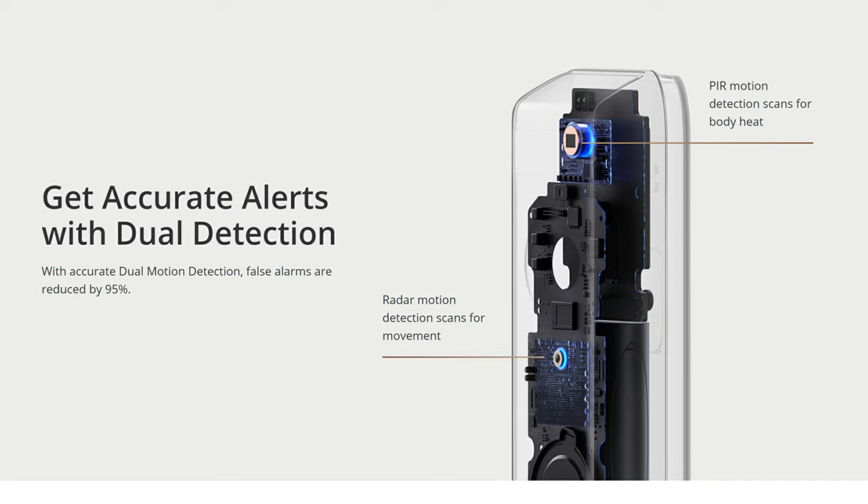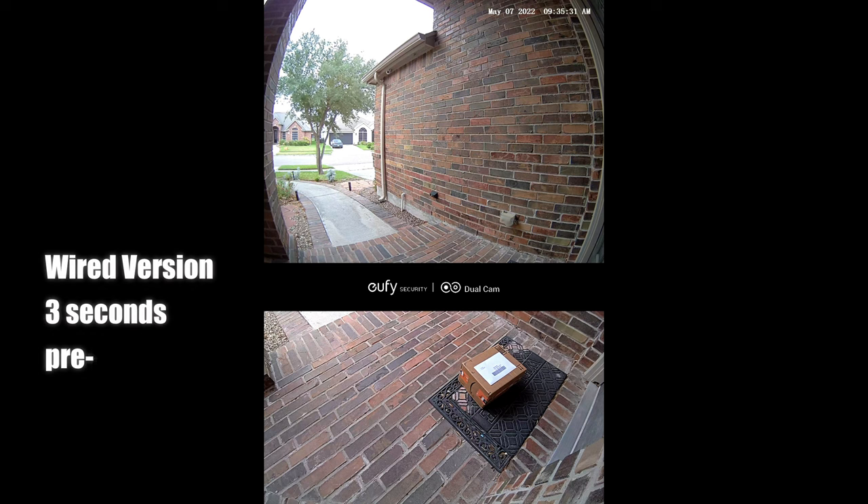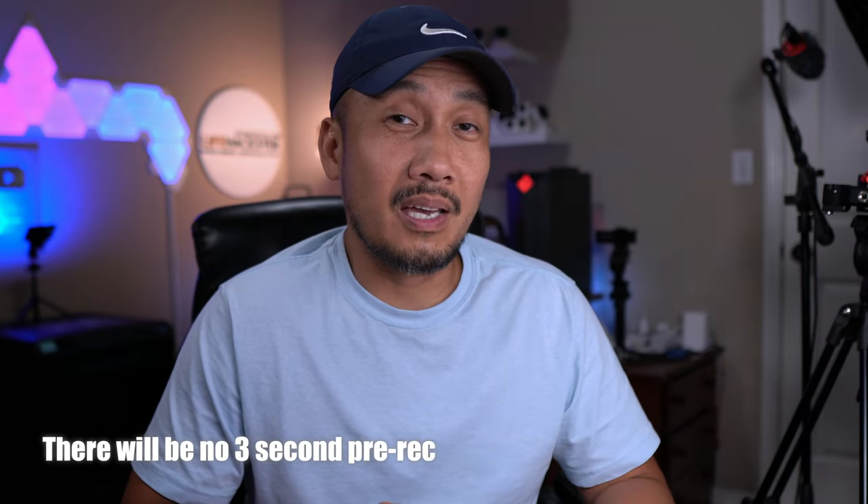What is reliable is their motion detection, and the wired version is more reliable overall. Battery-powered cameras will always sacrifice reliability, which you will see during my porch pirate testing. How these two doorbells detect motion is one of their main differences. The battery version uses a PIR sensor which detects heat movement, and Eufy also added radar detection to make it more reliable — but these two detectors only trigger the camera to record when motion is detected. The wired version, because it is constantly powered, is always on and uses the camera itself to detect movement. It will start recording and also add 3 seconds of footage before motion is detected, so you won't miss the start of the motion. To clarify, wiring in the battery doorbell with existing doorbell wires will not change how it detects motion — it will only charge the built-in batteries and sound your chime, still using the PIR sensor and radar for detection.